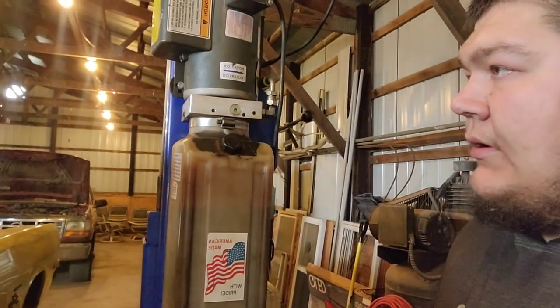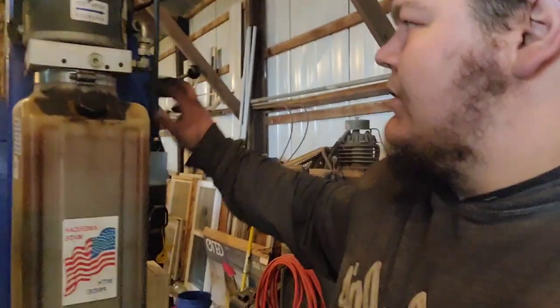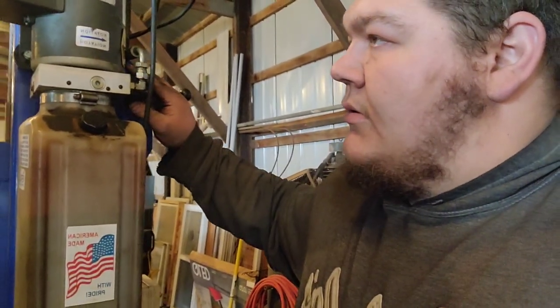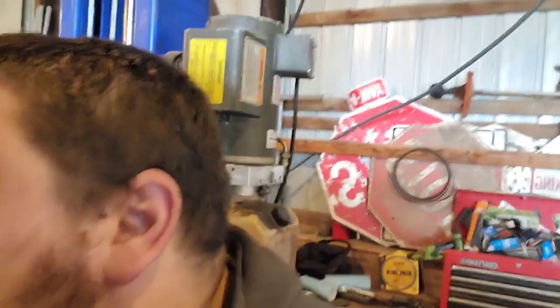I'm coming in with you. I got everything I need done now. Put this up on the first block. Yeah, that's like no good. All right. There it is. Okay. So I like to do that just so that it's sitting on the blocks and not sitting on hydraulic pressure. So I don't know why it still won't start in park. Adjusted the shifter a little bit. That seemed to do nothing, which whatever. Still starts in neutral. All the gears still work.